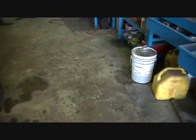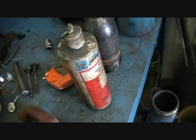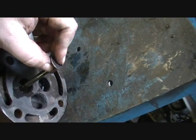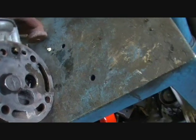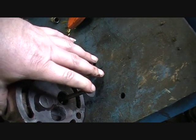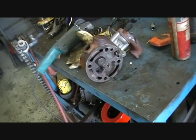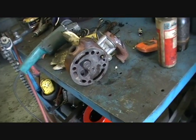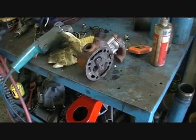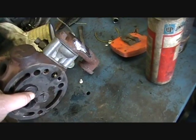We've got the head off and I've got the valves both broke free. They now actually seat in that head and slide in and out like nobody's business. So we got the valves freed up and working. Seats are in mint shape, the valves are in really nice shape — they were just frozen in the valve guides. The valve guides actually feel really nice and solid on this too.